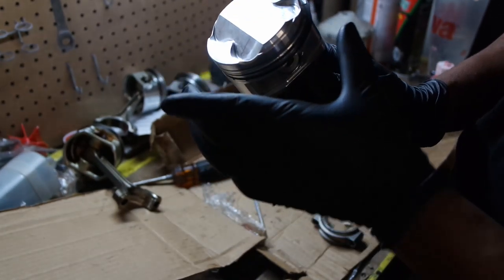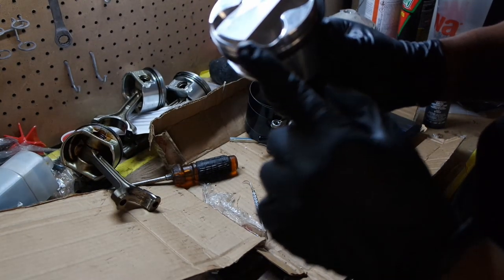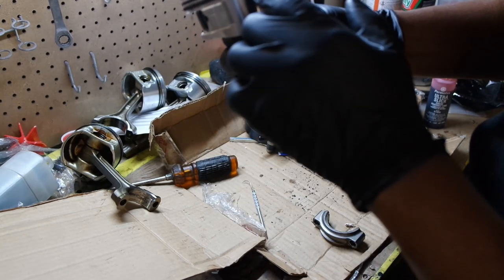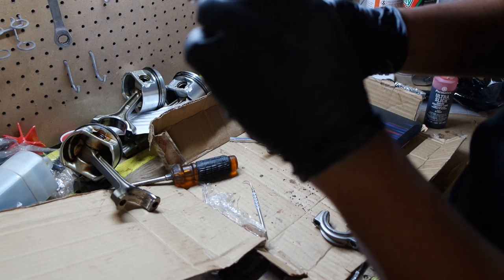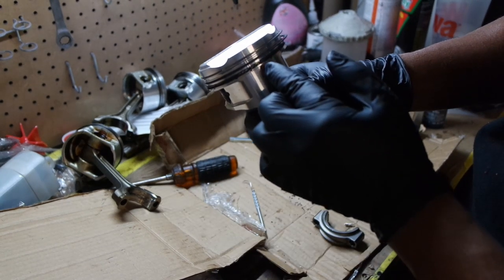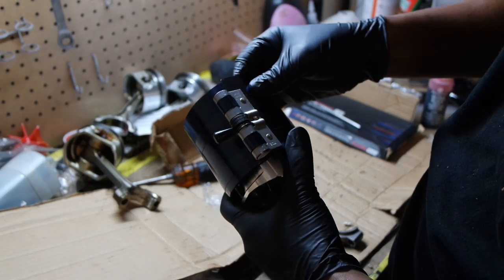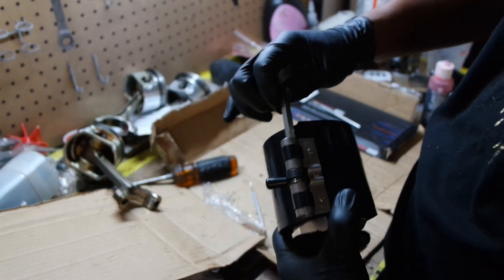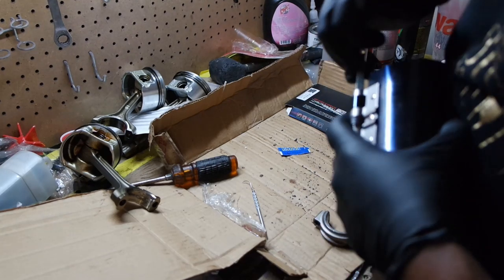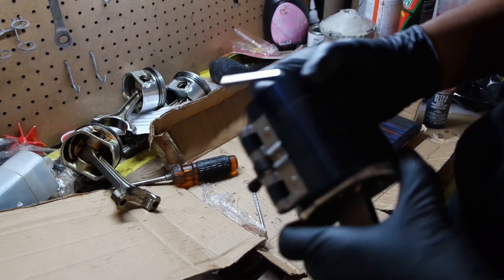I'm basically going to 180 all the rings. I got the top ring on the exhaust side on the left, and the second ring on the intake side, 180 from that. Then I'm going to put the oil ring's squiggly expander in the middle, sandwiched by two other rings — one to the left and one to the right — with the squiggly opening right in the middle. Once you do that, put the ring compressor tool over it. It comes with a little wrench and you tighten it so it compresses the rings so you can get it into the block. It's pretty simple once you use it the first time.